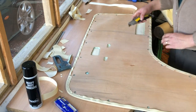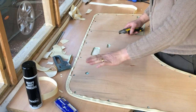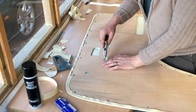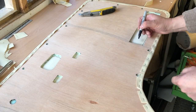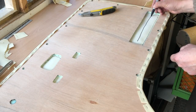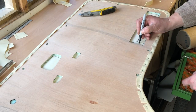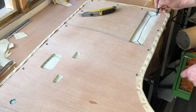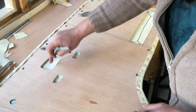Okay, final thing is apertures. The winder hole does not want pulling through, that just wants a hole bodged in it and away you go. The others, what you want to do is cut a fancy eye. What do we mean by a fancy eye? Slot down the middle of the longest bit, but with 45 degree lines going towards the corners, but stopping the thickness of your material away. By material I mean the wood and the padding in this case.